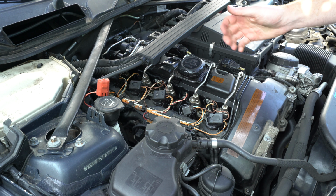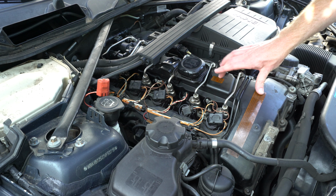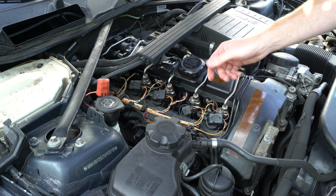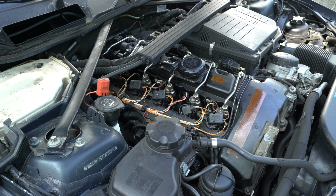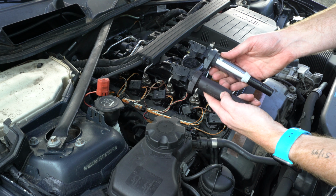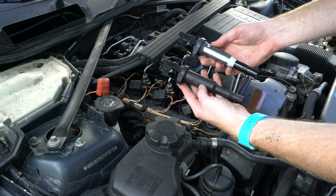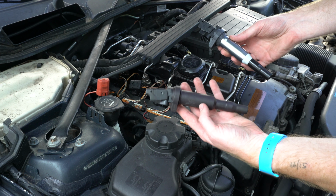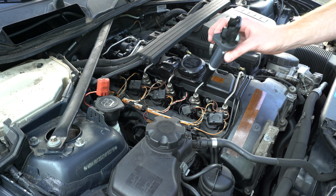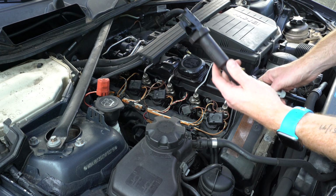And previously, back in November of 2018, I have a repair invoice from a BMW dealership that worked on the car, and they replaced the cylinder 1 coil pack, just one, and that's where the new Delphi coil came from. This one here that I just removed from cylinder 1. There is talk on the internet about not being able to interchange the Delphi unit with the Bosch, but interestingly enough, it looks like the BMW dealership that last worked on this car had no problem putting a single Delphi coil in the front here, and I'm going to guess that the rest of these are also original.